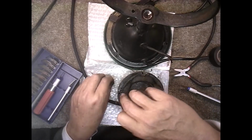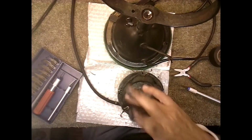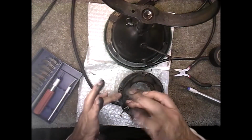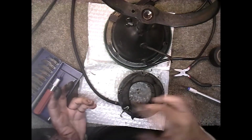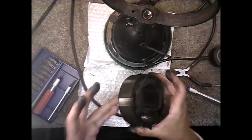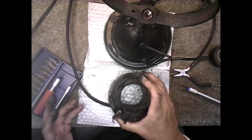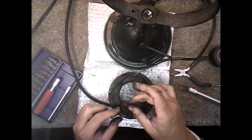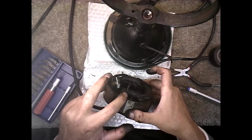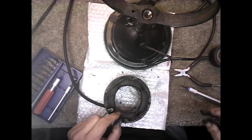And this is insulated coil wire. It's the actual field coil, so I'm going to just slide shrink wrap all the way down. And it's fine. You can see there, it goes nowhere near the stator. It goes right into the coil insulation. And this one does too. Right there. Goes right into the coil. You got plenty of tolerance there.